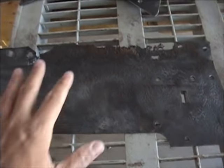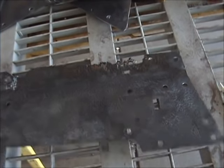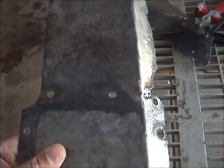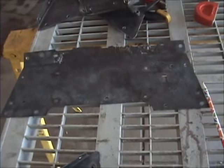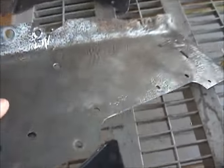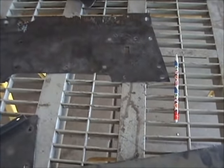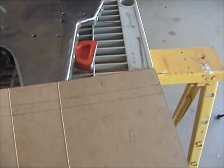What I've decided is to go ahead and just cut out the top part and weld onto it. The back of the metal looks really, really good and there's going to be some pitting, which will cause a couple of challenges. But overall it'll be a lot easier than trying to fabricate a whole new piece with the bends and the cuts and all that. So I've got another piece of that console all cleaned up and I've made a cardboard template. I'm going to cut out what I think is the right size piece to put in there and see if we can get her welded up.